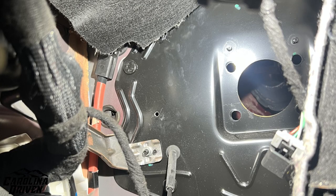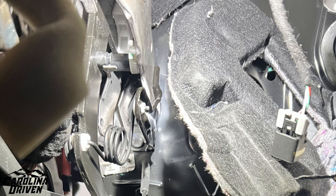I took the top bolt out from the dashboard, moved the pedal down, ran the bottom bolt in all the way so the pedal was completely straight, put it up against the firewall, and put a dot there. So I had one vertical line and two horizontal lines — where those lines crossed is where I knew I had to drill. I drilled a pilot hole, then drilled out for my actual stud hole.